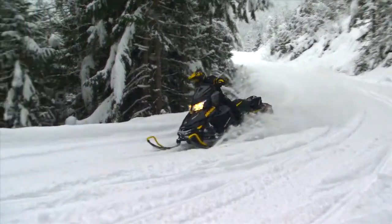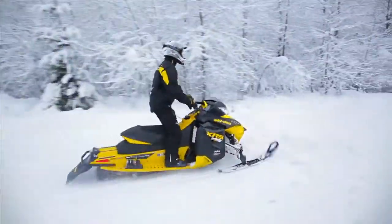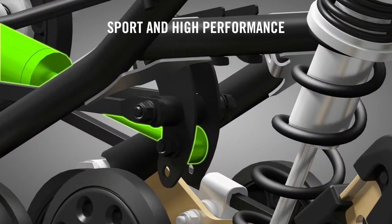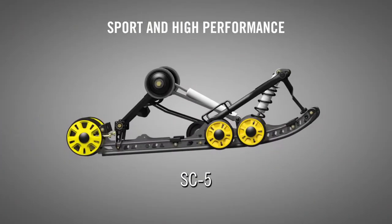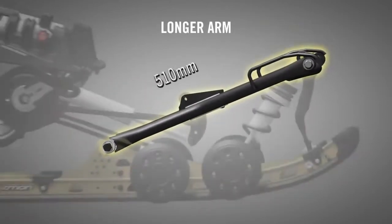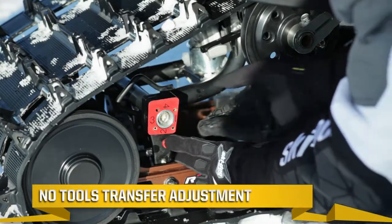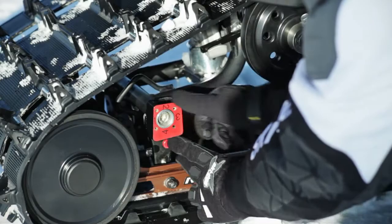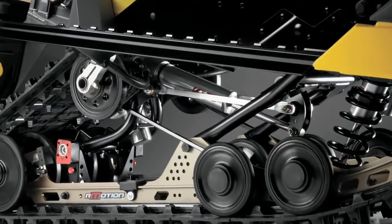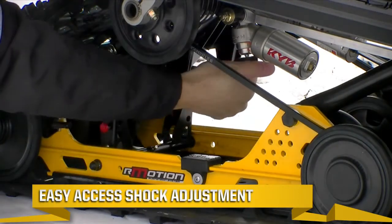Yet for those who like to fine tune, the R-Motion has several adjustments that are all easy to make. Two rear shock mounting positions offer two ride personalities: sport and high performance. A longer, more horizontal front arm makes weight transfer very predictable and controlled, even when throttling out of corners. Riders can also adjust transfer by rotating the coupling blocks — there are four distinct settings. An inverted shock position not only reduces unsprung weight but makes the compression speed adjuster easily accessible.